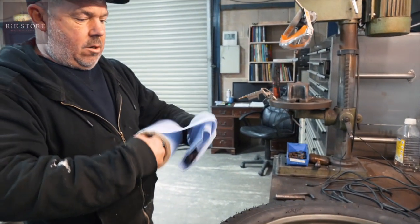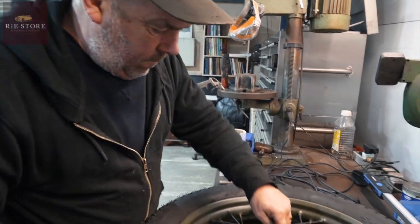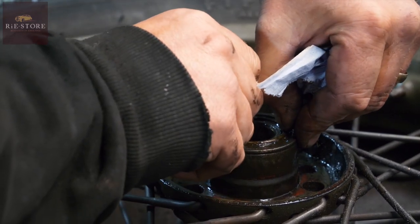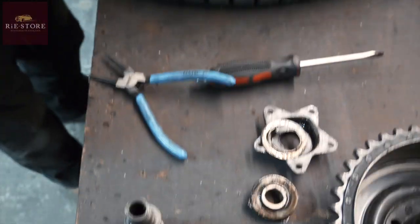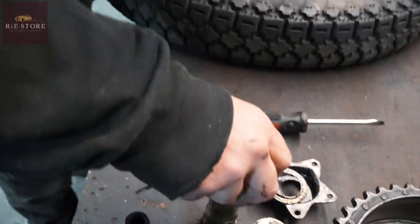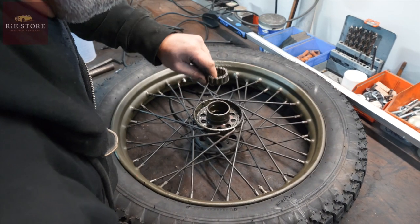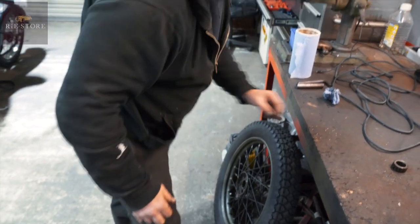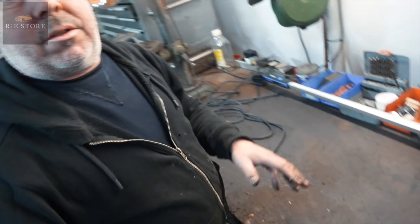All we've got to do is get it all apart, clean it all up, get all the grease out of it, and then you know exactly what you're dealing with. So you've got to take this side out. That's your centre — these can wear as well where your needle rollers go. That's your other oil seal. We can get this bearing out then — that's one cage, and that's your base washer. So that's all the bearings out. The oil seals are different sizes so you can't put them in the wrong way round.